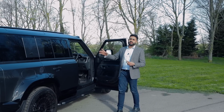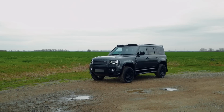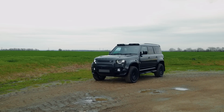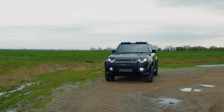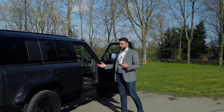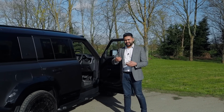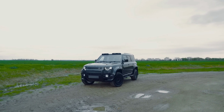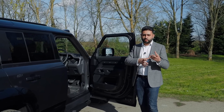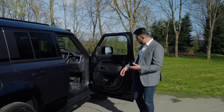And if you own one of these, you know these things rattle like mad, mostly because things are not tight. I've got another Defender 110 in my workshop at the moment, and that's exactly the same thing. Things are not secured down that should be. They rattle like crazy. So part of our soundproofing is not just about the sheet itself. It's all about the level of detail, and this is where the install becomes 80% of creating a good sound and 20% is the product.